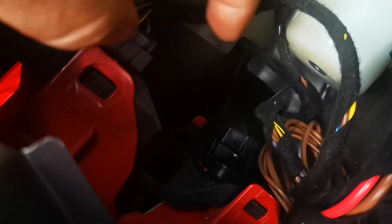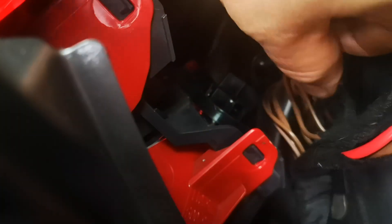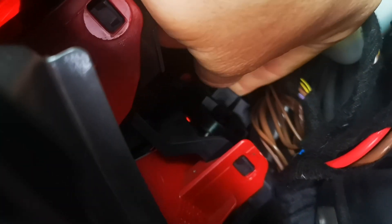Pulling off the trim allows you to get the formed carpet out of the way. You can pull that out, and then down here you have access to the lights and the bulbs. It looks like you can actually undo the tangs and pull the actual light assembly out if you want, but it's very tight.